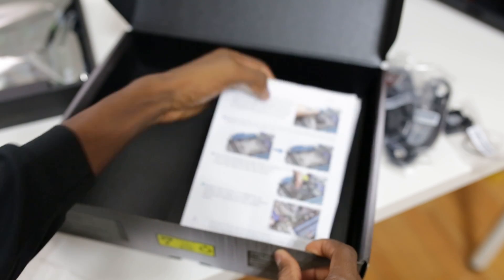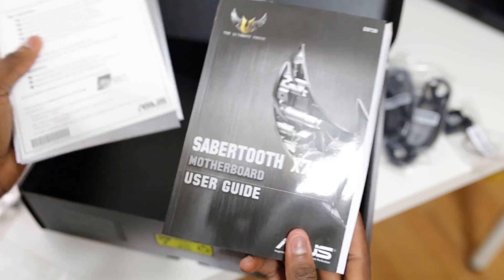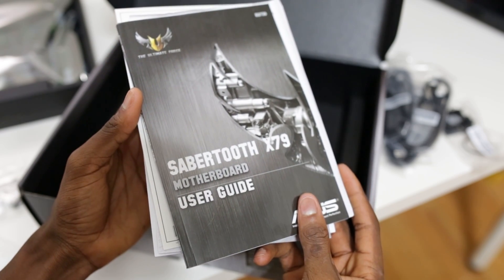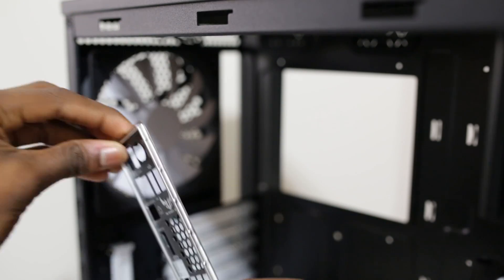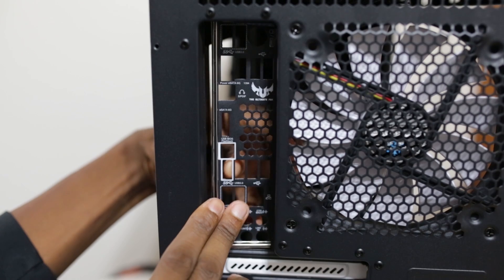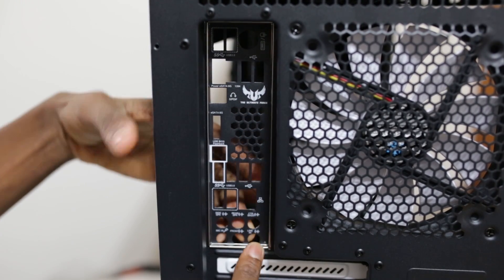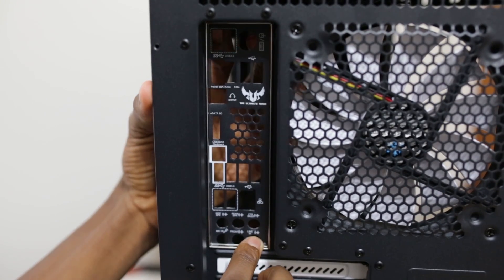Most importantly, you also get some useful paperwork. Every motherboard is different, so I use the diagrams and instructions in this paperwork to figure out which RAM slots to use, which cables go where, etc. First things first, you install the IO shield in the back of the case. It just snaps into the back of the Fractal R4. It's pretty durable, so don't worry about bending it — you can snap it right in place. We'll use that to guide the motherboard into the case later.